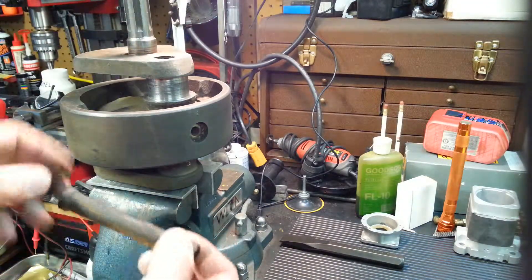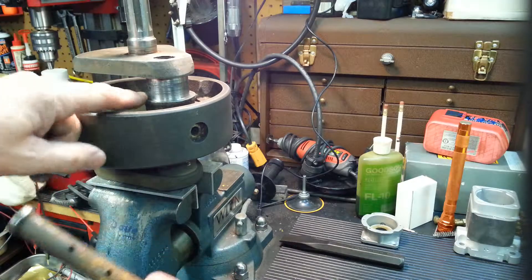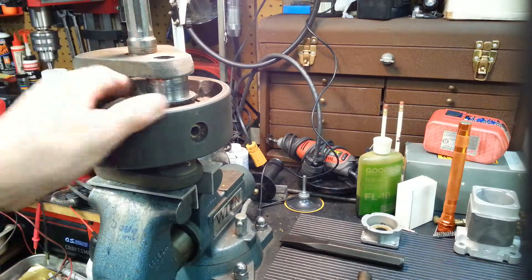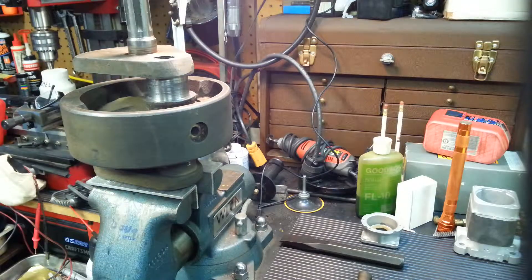This procedure of cleaning everything out — cleaning the sludge trap tube, blowing out all the holes for the journals and rod bearings — is definitely 100% a must when you rebuild one of these motors. You want the motor and the rods to get proper lubrication. You don't want junk inside where it doesn't get enough oil. So you definitely have to remove these plugs.